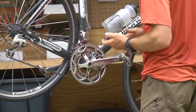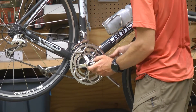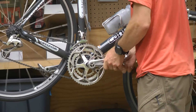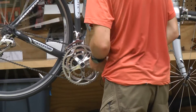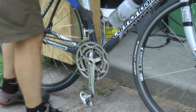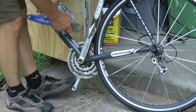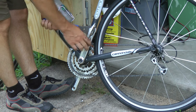It's been a long time since I've changed the bottom bracket, but I don't think it's too tough. I don't think I have to remove the chain — it helps so you can loosen this nut up first. Probably a good idea to take the pedals off before I take the crank off. To do that I had to put the bike down on the ground. Don't forget that the one on the side away from the crank is reverse threaded.